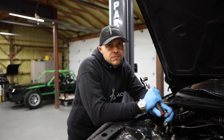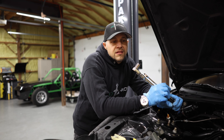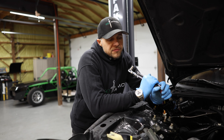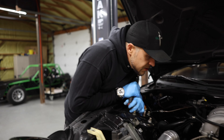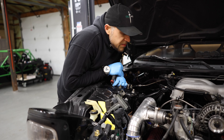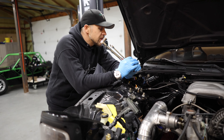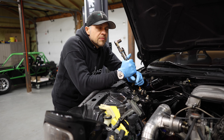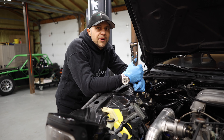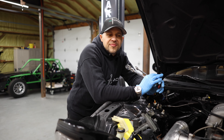That could just be the turbo dialing back boost — one of the issues with turbocharged cars as you get closer to a high redline. This may fix that and completely change the power band, which would be wonderful. This shouldn't be too painful — hopefully. This is a water-cooled Garrett, so we have coolant lines going to the turbo, plus the oil drain and oil feed. I already disconnected the down pipe from the mid pipe. I can pull this whole assembly out with the Greddy Type R wastegate, which is rerouted into the down pipe — I'm not about that open wastegate screamer life.